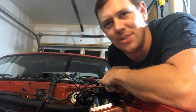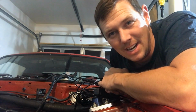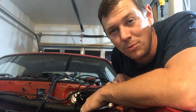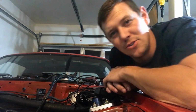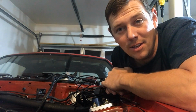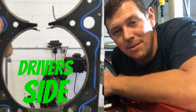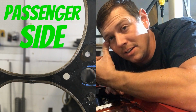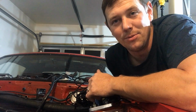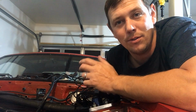Well, I've got some great news I figured I would share with you guys before we end this video. I got the engine over to the shop. I figured the damage was way worse than it was, so I took it to my engine guy, and he sent me some pictures and some preliminaries. It looks like the head gaskets are what failed because of going lean and overheating. I got coolant in stuff, and that's what made it sound so funky. But also that's what discolored the pistons and made it look like they were damaged.